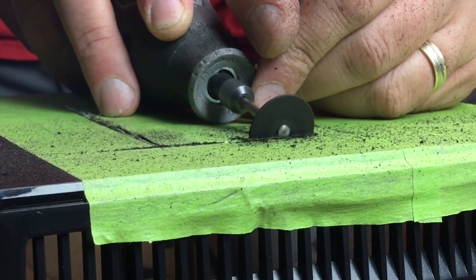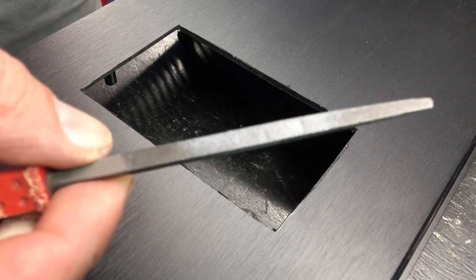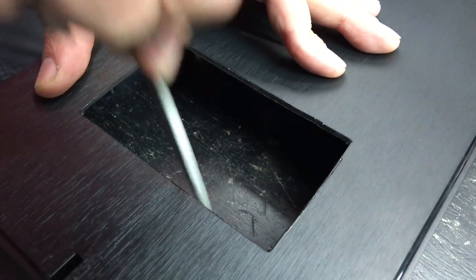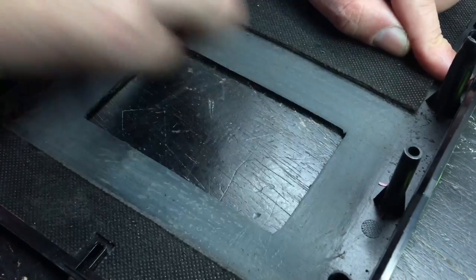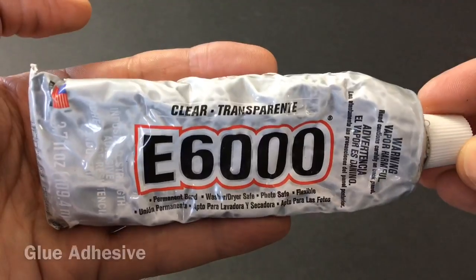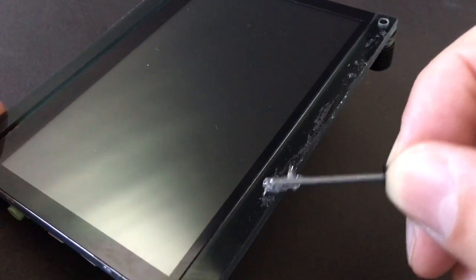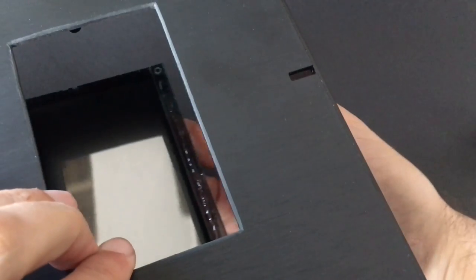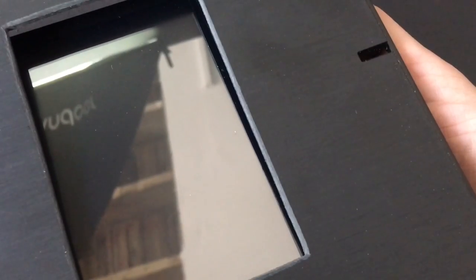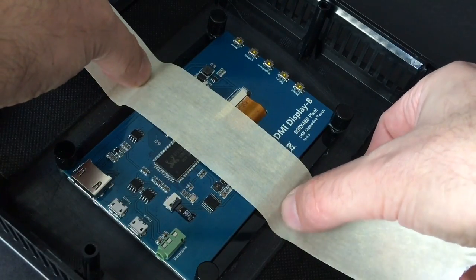So finally, after cutting our 5 inch diagonal square hole for the LCD, I'll hand file the edges so it's nice and precise and clean. You may have to remove sound insulation foam from the back side of your bezel depending on which case you have. I'm using E6000 adhesive to attach the two mounting brackets. This adhesive is very gooey at first, so consider masking off your screen to prevent getting any of this goo onto the screen.